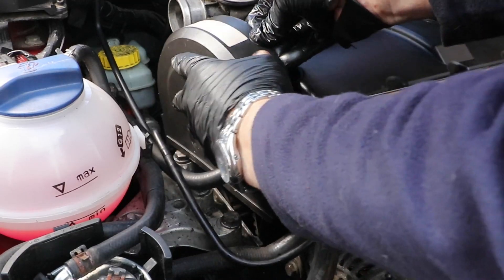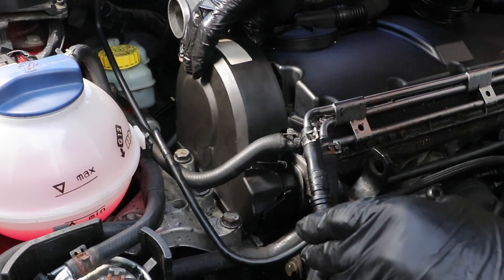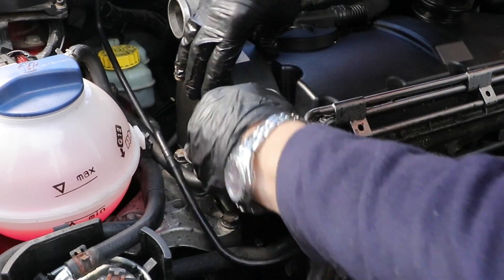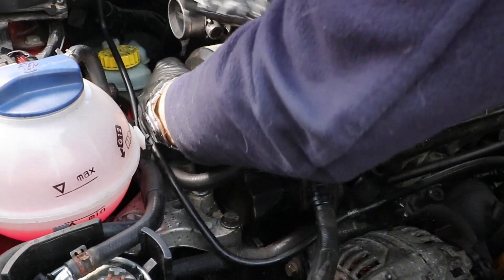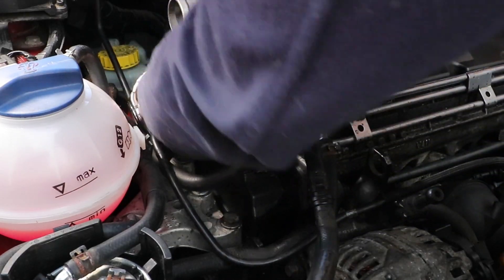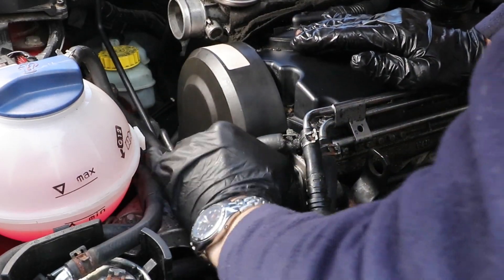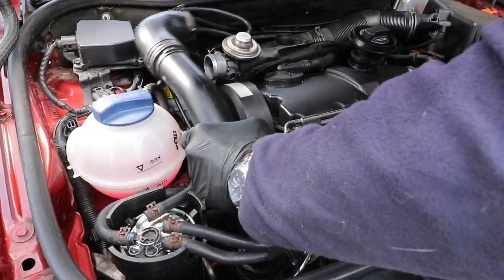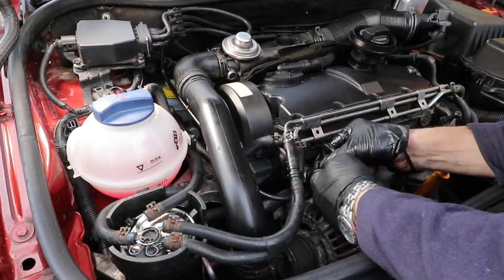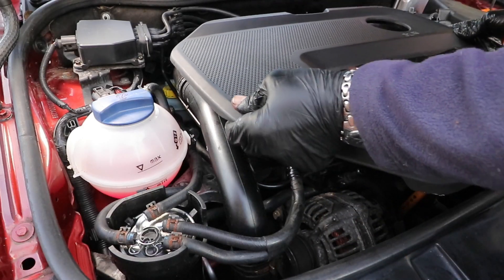Putting the cover back on, make sure the plastic goes into the slots at the front and the back and over the little lip on the top of the rocker cover. Keep jiggling it about until it seats nicely, then make sure both clips are clipped into place. Refit the intercooler and vacuum pipes and the job's done. All you've got to do is test it and enjoy the improvements. Hope this helped you out guys — thank you for watching, please like, share and subscribe and I'll see you on the next video.